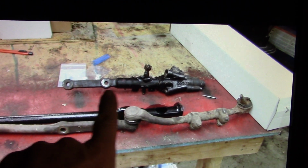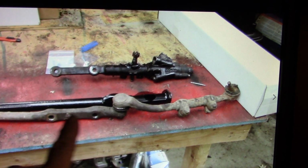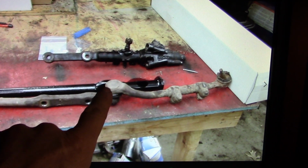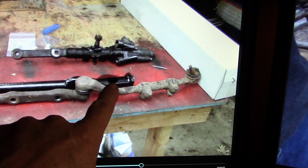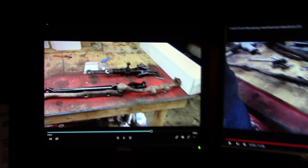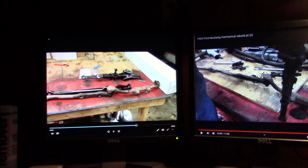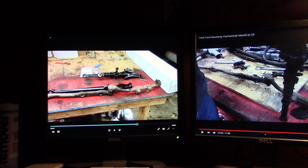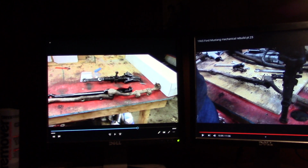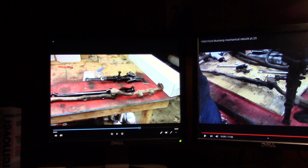actuator has this piece right here screwed into it, that's a 6-cylinder attachment, which means this is a 6-cylinder center link. This one behind, which I'm probably not going to put in a video right away unless you all just want to see it, I bought new. This one is the V8 one. So there is a big difference, and the tie rods are different sizes left to right, meaning one side has got a lot bigger threads and the other side does not. CJ Pony sent me one size on the passenger side, meaning one was the big thread, one was a small thread, and it would not work.